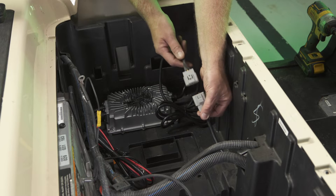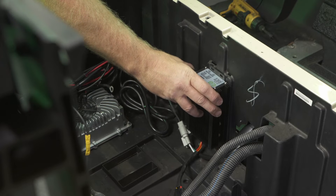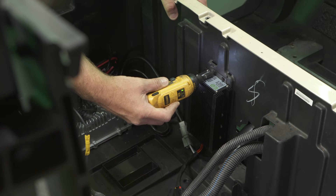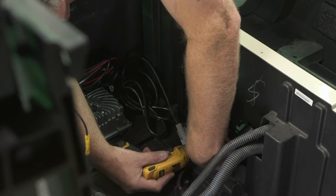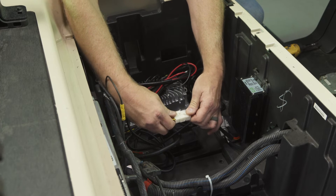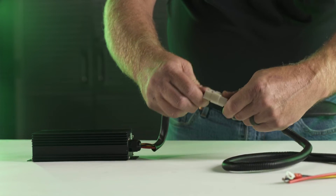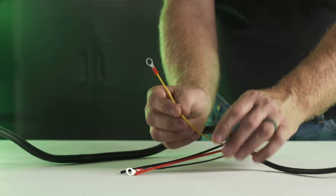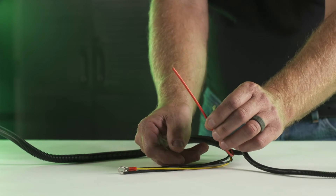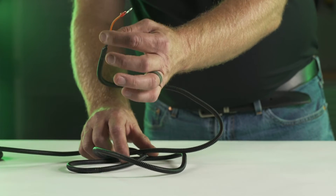Connect the gray Quick Connect connector to the corresponding connector on the charging port. If your cart has lights or 12-volt accessories, install the 12-volt converter using the 12-volt converter quick start guide and the provided diagram — the guide is linked in the description below. Install the DC to DC converter in a convenient location. Connect the DC to DC wire harness to the DC to DC converter, making sure the connector snaps securely. The small yellow wire connects to the main battery positive, the small black wire connects to the main battery negative, the larger red and black wires connect to your positive and negative 12-volt accessories, and the orange wire should be connected to a key-on power source.